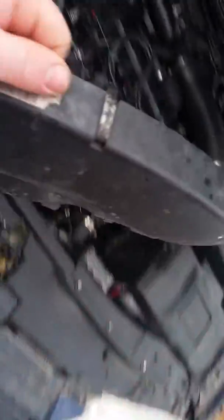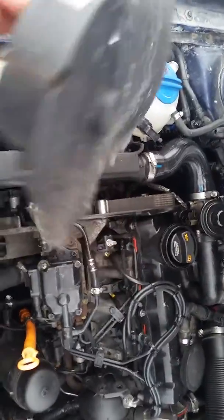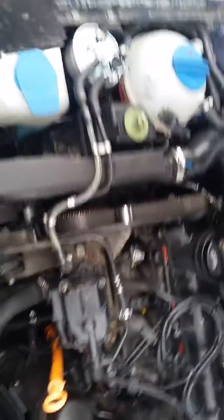To adjust it, you need to remove the timing belt cover — it's held by three clips, plus a couple more on the engine itself that I don't bother with since the three are more than enough. On the injection pump sprocket, you'll see three 13mm bolts. Never mind the big bolts in the middle. You're going to loosen those three 13mm bolts — not remove them, just crack them loose, about half a turn, maybe slightly more. Don't go further or the pulley could fall off and you'll have a full timing belt job on your hands.